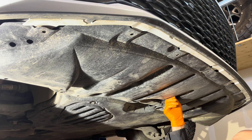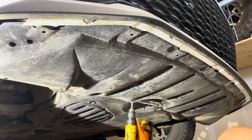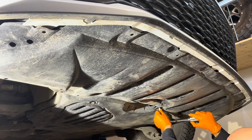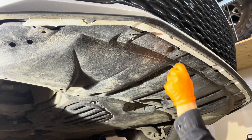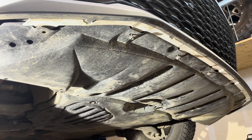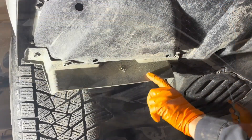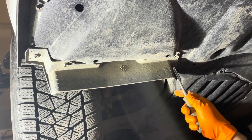Now reinstall these three bolts and tighten them to 66 inch-pounds. Get the eight screws in from the front — there's no torque spec on them from the manufacturer, but they go into plastic grommets, so just don't over-tighten them. Don't be using an impact gun; just snug them up by hand. Lastly, install the wheel opening extension covers, one on each side, with four screws, and tighten those by hand as well.